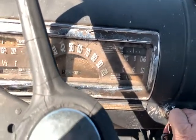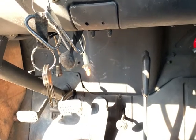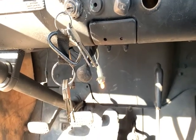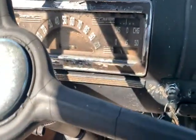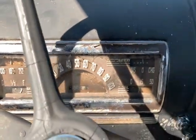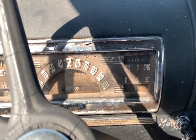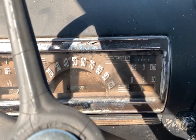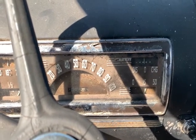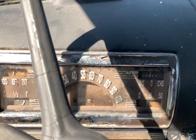So we have this turned off. When we turn it on, we can see down below. I have the light hanging — the light turns on when the alternator is not on. Start it up and the light goes off. So I get about 15 on the oil pressure. When I press it and give it some gas, of course it goes up. Jim Carter mentioned that it could peg out at 30 often when accelerating.